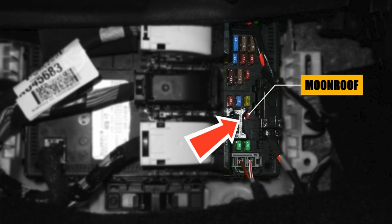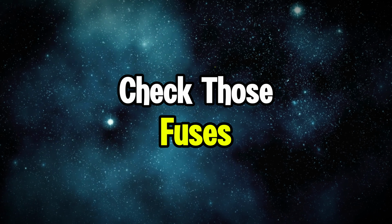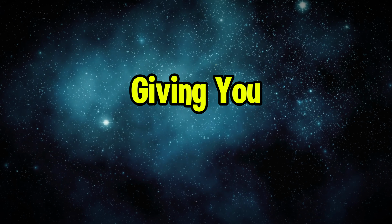Look for the little red 10 amp fuse. That's the one dedicated to the moonroof. If that fuse is toast, swap it and give it a test run. And that's it. Super simple. Check those fuses if your moonroof is giving you trouble.